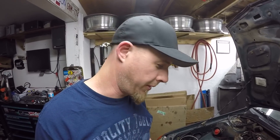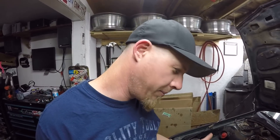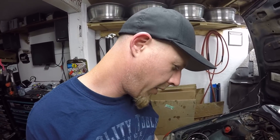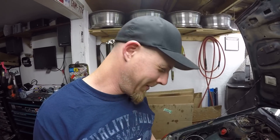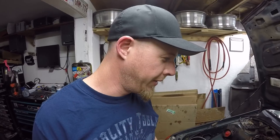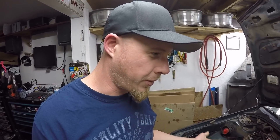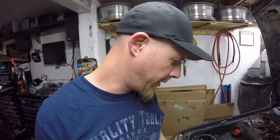Mainly because I just don't have a lot of time to waste. I know the other pump is a good known pump, and putting it on this engine should make it not have a problem anymore. I can't think of any other oil restriction this thing would have — there's no modification to the head gaskets required, so all the oil would just make its way up into the heads, and the oil return galleries are huge on these things.